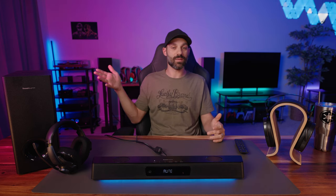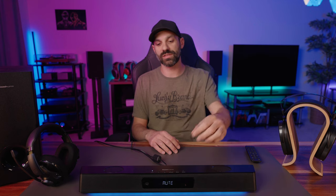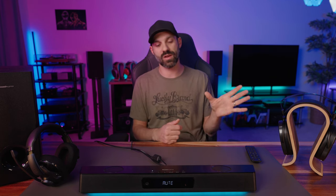I don't know if I'm coming across animated or unorganized or not, but this thing really surprised me for the better. And it's even just a little attention to detail thing. So when I tested this without blowing my eardrums out, because I paused the music, I put my headphones up to volume 40. Now, a common thing that happens with amplifiers is you unplug the headphone, then all of a sudden your amp is crazy loud and your speakers are either getting blown or blowing your eardrums or just very, very loud and uncomfortable. This will maintain independent volume settings for both. So when I unplugged my headphones, it went back to volume level 12. So I wasn't worried about destroying my ears or waking everybody up because I unplugged it accidentally.